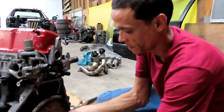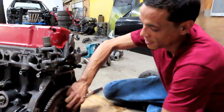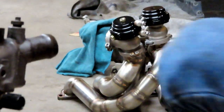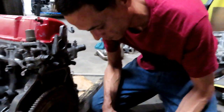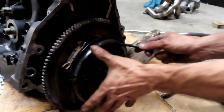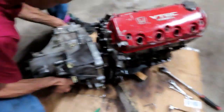Hopefully we can enjoy it. I want to get a couple passes out of it, and if not, after that I'm definitely going D-to-B. I'll try to take the LSD out and keep it for something else, but probably end up going D-to-B. It's really the best way — I'll just get a stock GSR or stock B16 tranny and shend it. Look at that twin disc looking hella clean over there — multiple clutch discs, yes, multiples.